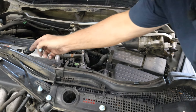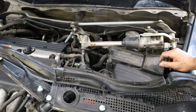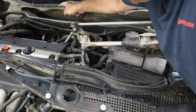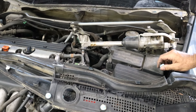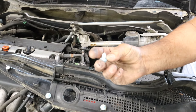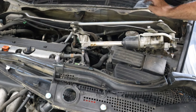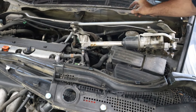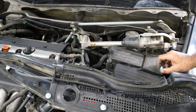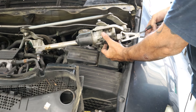I called the dealer to try to get some of these clips because you couldn't get them aftermarket, and of course they're on national back order. So what I did was I had a couple of these clips that were still good and I left the plastic tab in there. Talked to the customer, and he said he needs to just secure it the best I can. So I had these clips in stock — I pulled out the little plastic housing that this snaps into, and it looks like it's going to fit in there just fine to hold it down. Let's go ahead and get this motor assembly away from the car so I can build it.